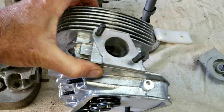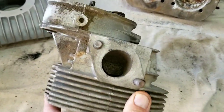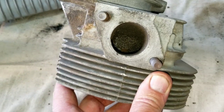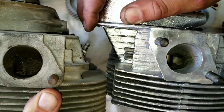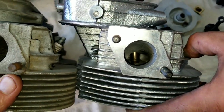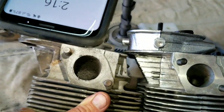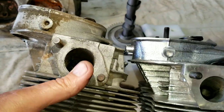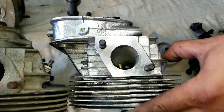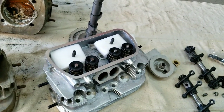The exhaust ports — look at that. If you look at how that just goes straight through to the valve on the AA head, and then you look at the stock one, it turns almost a right-hand corner. It's like there's a big old giant clump in there. Comparing the two, with the light on you can see how much more is in the way in the stock one — it almost makes a right-hand turn. The AA head kind of just flows straight in. Those subtle things are a really huge difference when it comes to head flow.